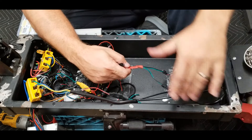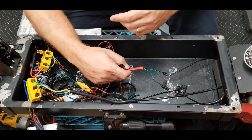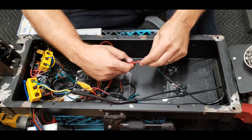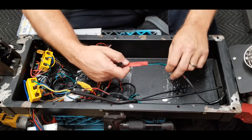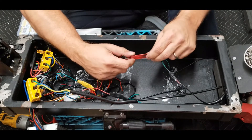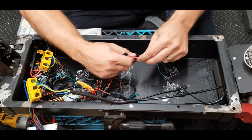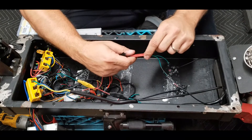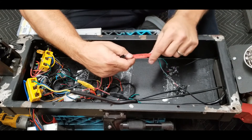You can get different lighting for these — 6 volt, 10 volt, 12 volt lighting. In the old days with lead-acid batteries they were 12 volts and you just hooked it up and called it a day, but with LED lighting it needs a different type of voltage. They do that with DC to DC voltage reducers, and you can find these on eBay and a lot of places. Some of them are adjustable — those ones are a little more expensive but they go for like $5 or $10.